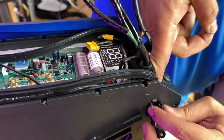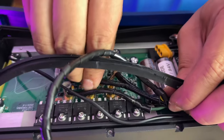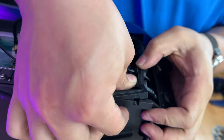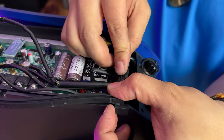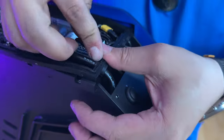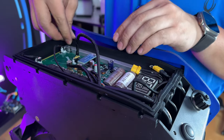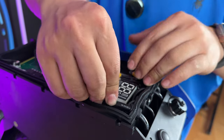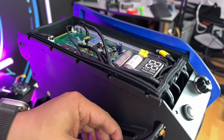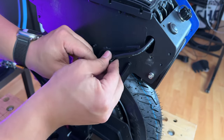For the motor cable, just make sure you get these plastic clips out and you don't lose them because we'll need them later. Make sure your seal is properly aligned with all the holes and the ridges. Once you've done that, you can go and re-secure these clips.